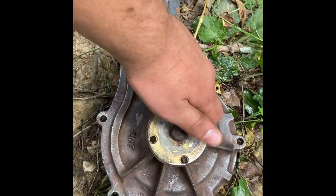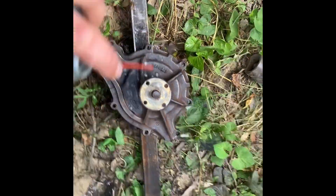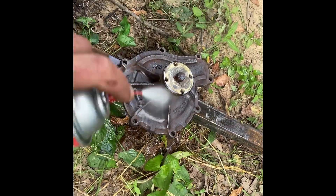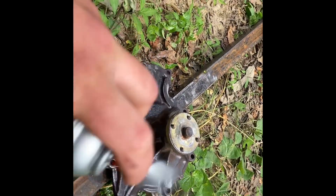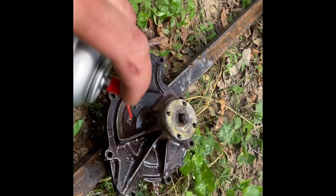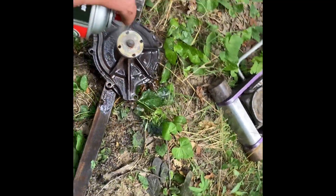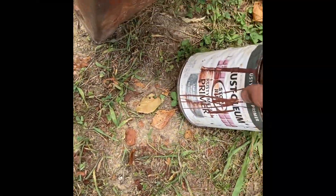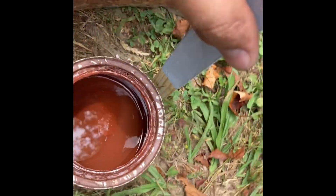Getting all the oils out of it and then primer it so the paint doesn't peel off. While it's nice and warm I'll clean it off a few more times. This is the best way to do cast iron — I learned this from Uncle Tony's Garage. It keeps it good looking and the paint doesn't peel off; my motor's got about a thousand miles on it and still hasn't changed. Now I'm going to wipe that off and put Rustoleum rusty metal primer on it. I'll mix it up with a stick because it can be pretty thick, brush it on, let it dry for about 12 hours, then spray paint it.